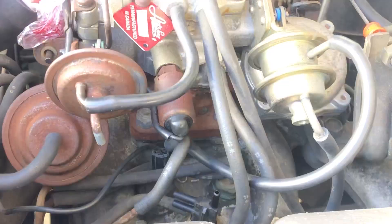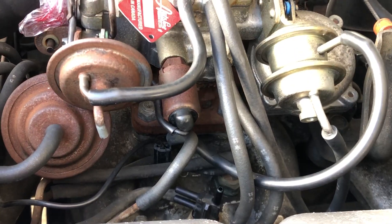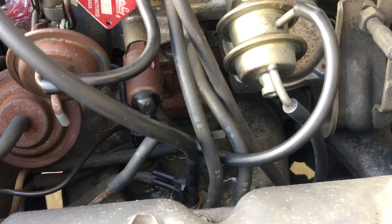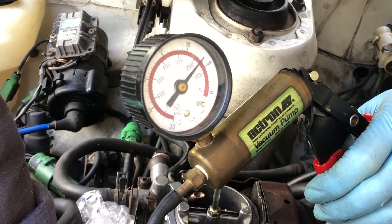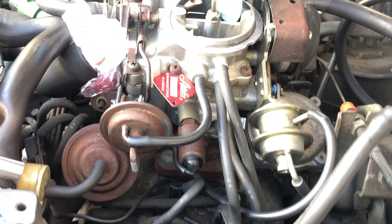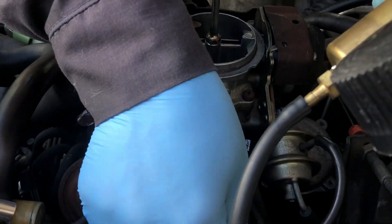Now let's test the valve and see what it does. Disconnect the intake manifold vacuum hose and the other hoses. Remember, right now the engine is cold — this passage is supposed to be closed and this passage is supposed to be open. If I close the top passage, I'm not supposed to be able to build vacuum, but you can see I am, which means the top passage connected to the choke opener is open right now. The choke opener would actually open the choke when the engine is cold, which is not good. So at this point I'm going to have to change the BVSV, and in the next video I'll show you how to do that.